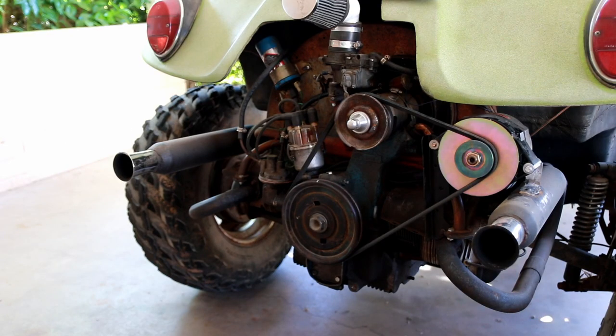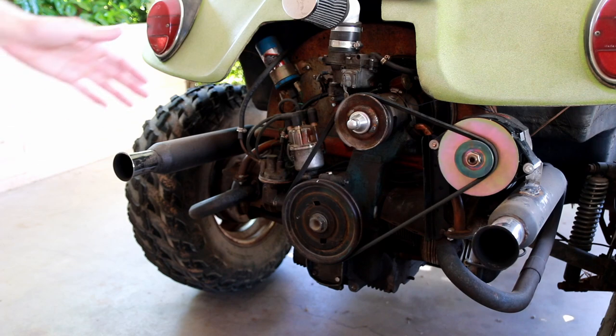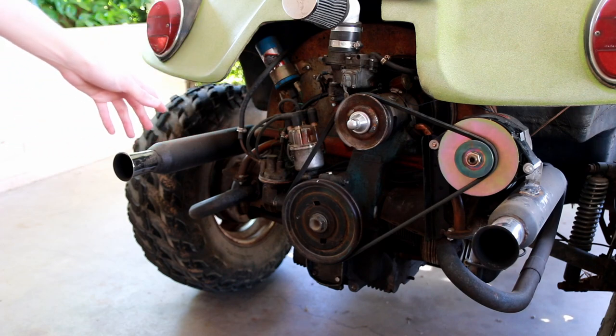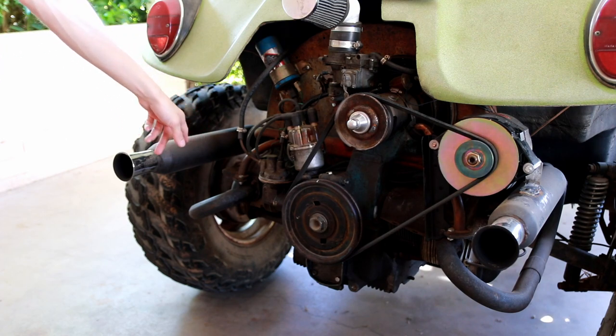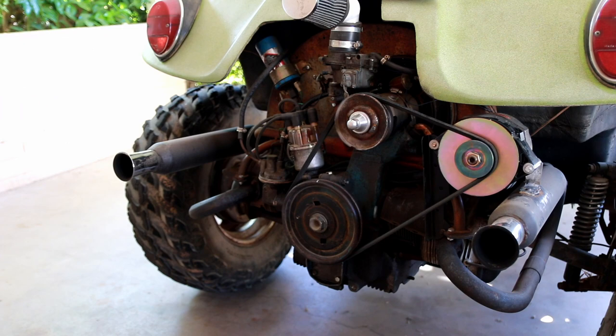On the Engine Revival Series Part 4, a commenter named Capitan Camote Picante said those twin pipes destroy horsepower. And that is actually quite true in that because they don't promote scavenging from the exhaust system, basically they don't take the pulses of exhaust flowing out from one cylinder and use them to augment the withdrawal of the secondary pulses from the other cylinder, they're not particularly effective at increasing the removal of exhaust gases from the combustion chambers.